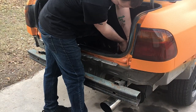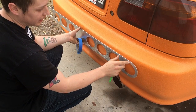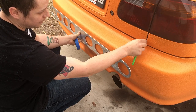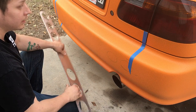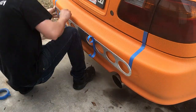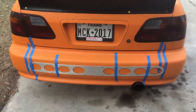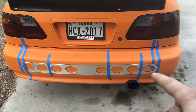I'm gonna go ahead and remove that, and then we'll mark on the bumper where we need to cut and then we'll get out the saw. So I got the bumper back on. These holes right here — I was just gonna line them up with the trunk crack, but they're not spaced out enough for that, so I'm gonna go closer. That's pretty much perfect, the exact same length, looks pretty level. So what I'm gonna do is drill the holes for all of these and then we'll take and cut out with the sawzall all this stuff. I'm gonna go ahead and mark all that so we have it all marked. It looks pretty even, it doesn't look too crooked, so I'm just gonna go ahead and drill the holes so the holes are there and then we can mark where we need to cut out the actual hole parts.